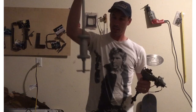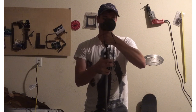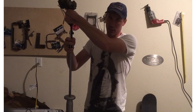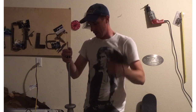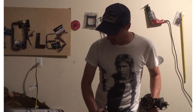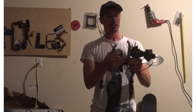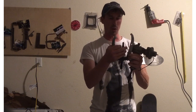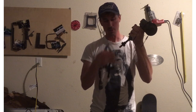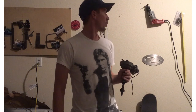I used a slide hammer — just get it on the gear. I had my wife use the slide hammer and it moves probably an eighth of an inch every time she slid the hammer, so it wasn't too bad. Another thing you could do is use a gear puller. This one's a bit wonky, but a good gear puller ought to pull a distributor gear off.